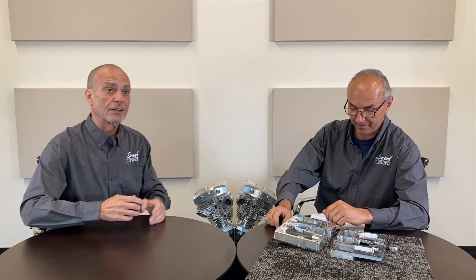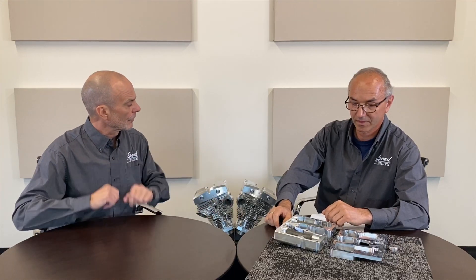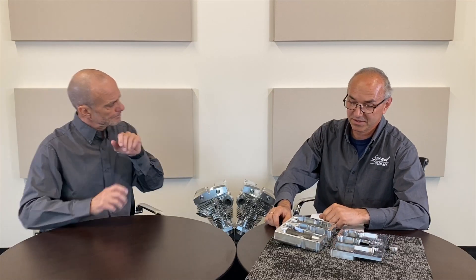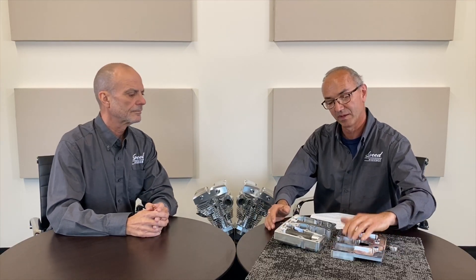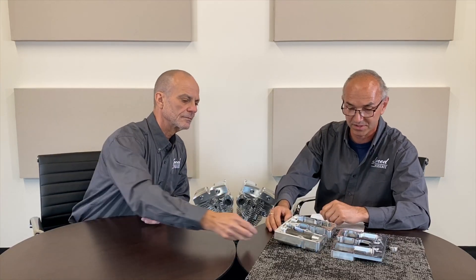It's a really good-looking engine Mark, but apart from its good looks, what are the improvements over the OEM components? The original rocker boxes started as a sand-cast piece with holes and such machined afterwards. It's an okay method for mass-produced components, but it carries a lot of inherited shortcomings. The most common issue was always oil leaks. The mating surfaces on the original boxes are nowhere near as flat as they're supposed to be. The valve-to-rocker-arm geometry is far from optimal.